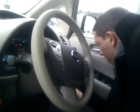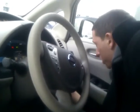Down on your right-hand side there are buttons that say AC timer, and another one for power with a picture of a plug. These are the buttons for setting the car up for charging. You can pre-program it to always come on charge at a certain time — for example, you can bring it to a post at home and plug it in, but the charging won't start until off-peak electricity is available, saving you more money. You can pre-program all of those settings into the car.